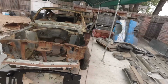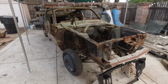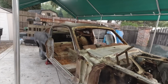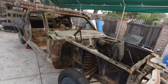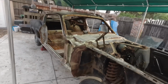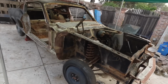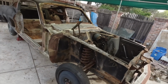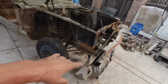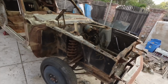And in this car, because it's a one of one, I would honestly never do an Eleanor with this, or even a Bullitt. This is that perfect car to do an original restoration, because it's a one of one car, AC option, California car, almost no rust on it. When people say there's no rust on it, surface rust doesn't count. It's the rust through areas, and there's almost no rust through spots on here. The frame rails are good. Torque boxes are good. Firewall is good. Everything is solid. It's a solid car to start with.